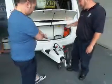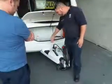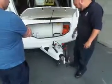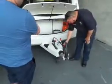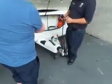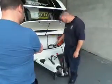If you're on a slight downhill or forward slope, it will automatically pull itself on further. So if it shoots up to back here, don't worry about it. It's just the more tension that the brakes need to stop the caravan from moving. And then onto your jockey wheel. There's winds up and down on there, and then you can raise it up and down on the side one as well. But I'll show you more of that when we're hooking it up onto the car. And then the last one on the front end is just your power. This does all your lights and also the power for inside for your fridge and bits and bobs like that. We'll test all that out.